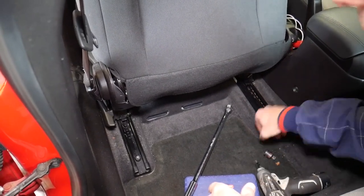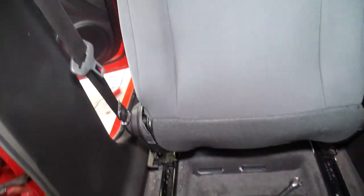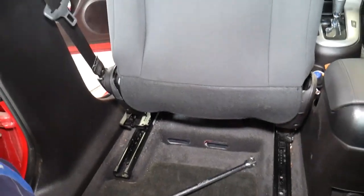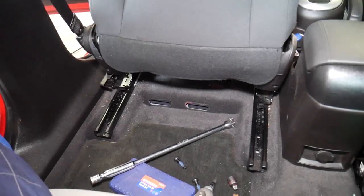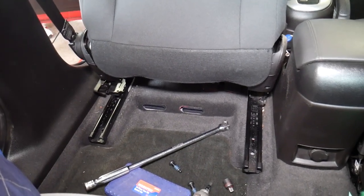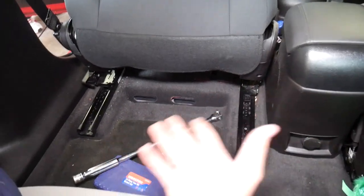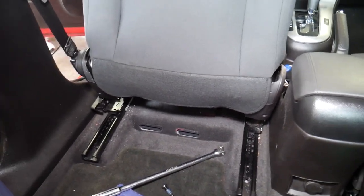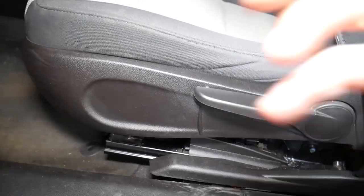For the next step, your car battery must be disconnected — we could have done that earlier. Disconnect your car battery at least one hour before you start removing the seat. Why? Because we'll have to unhook the seat belt tensioners and the wiring harness, as it's part of the airbag system. If you're not careful with the airbag system, those things can kill you.